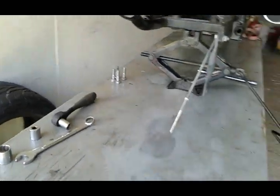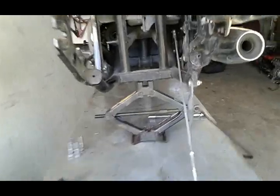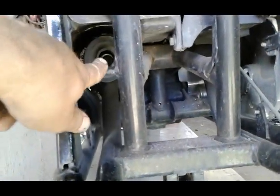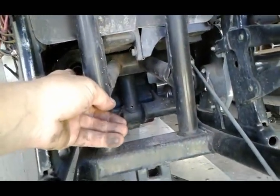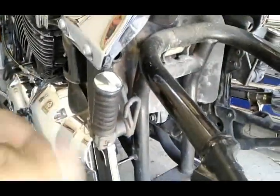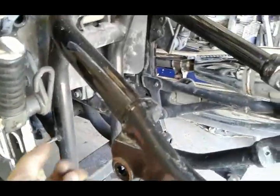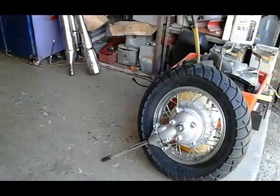The whole assembly slides out. When you're putting it back, you can see here the drive shaft — you gotta lay it on here and start sliding it back and it'll find its way in pretty easily. You might want to put the bike in gear so as you're turning the drive shaft it'll get into the spline easier.